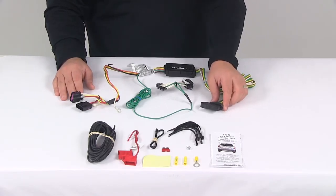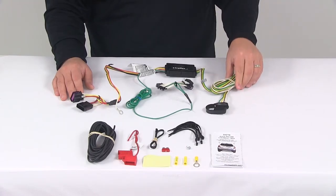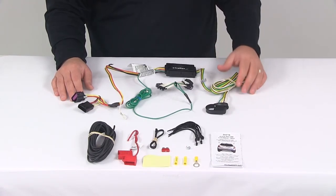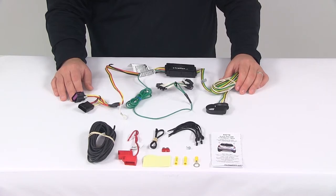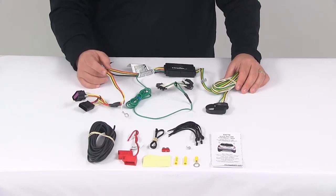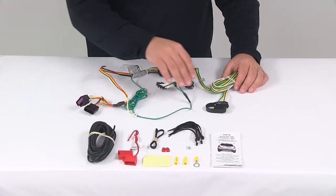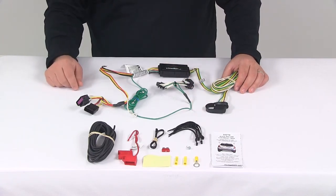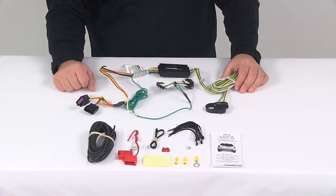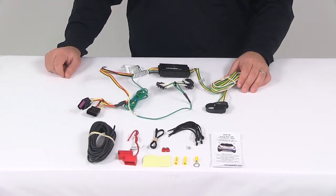Once your install is complete, the four-way connectors are stowed in an out-of-the-way location within your cargo area. There's plenty of wiring so you can pull it out when you need it and tuck it back in when not in use. For maximum amperage, stop and turn lights are rated at 3 amps per circuit, and tail lights at 6 amps per circuit. We also recommend using a small amount of dielectric grease on all your electrical connections, including the plugs on the vehicle and the four-pole connector itself, to help protect those connection points from rust and corrosion. That is sold separately and can be found at eTrailer.com.